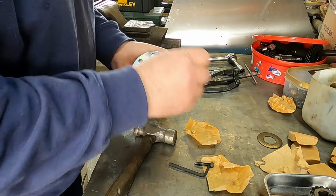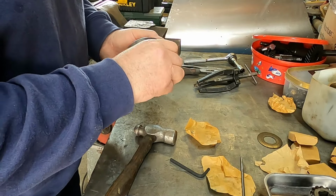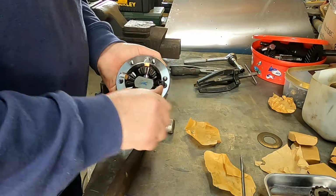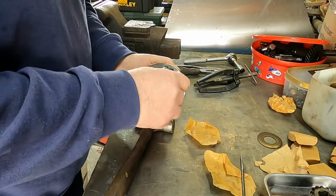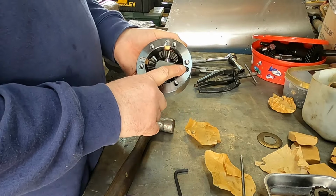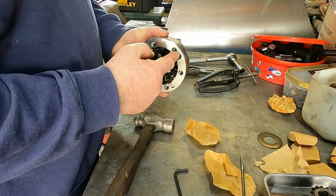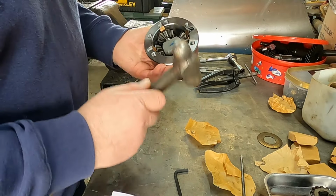Hole lined up so that the screw goes in. And we tighten up the screw. Now that screw can't back out because it butts up against the crown wheel. In other versions they still used the pin, and the pin could back out, and then all manner of things go wrong.